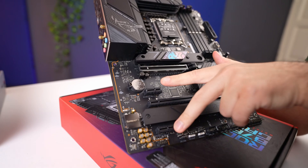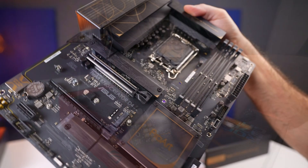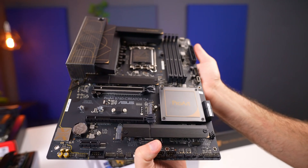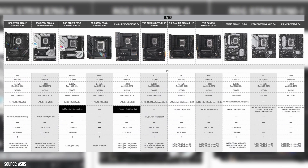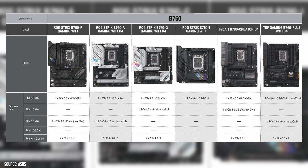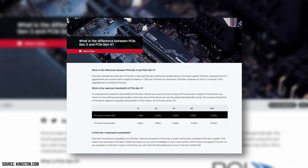Additional expansion slots no longer connect directly to the CPU — they go through the B760 chipset. In ATX-size boards you may have larger x16 slot connections, but on the boards shown here they are all electronically connected via only four lanes, so bandwidth is limited. Don't expect to plug in a high-end graphics card there and have it perform at full speed. Some boards like the Strix G Creator and some TUF Gaming boards run these lanes at PCIe Gen 4, while others run at PCIe Gen 3. There are also shorter x1 slots — either Gen 3 or Gen 4 — useful for sound cards, wireless or wired network cards, extra USB ports, or lower-end SATA or NVMe drives. With PCIe Gen 3 you're limited to 1 GB/s speed and with Gen 4 it would be 2 GB/s.